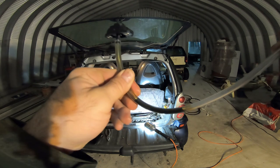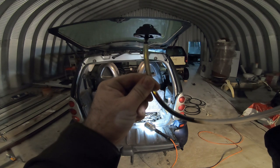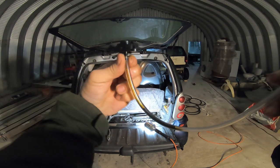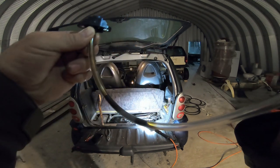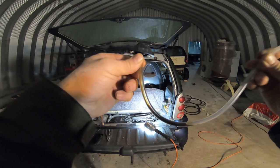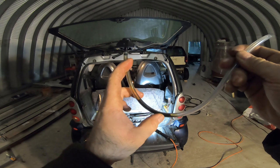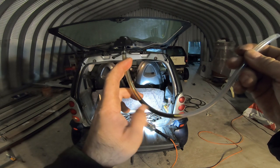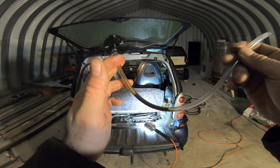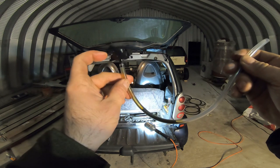The hose is sitting with a little bit of oil in it. When you apply pressure to it, you're not getting the appropriate pressure to the MAP sensor. Even though pressure from the manifold may make that bit of oil move, it's not the same as being open to the manifold. At idle there's a vacuum; when the turbocharger comes on there's pressure — so you're not getting an accurate reading, especially at idle.